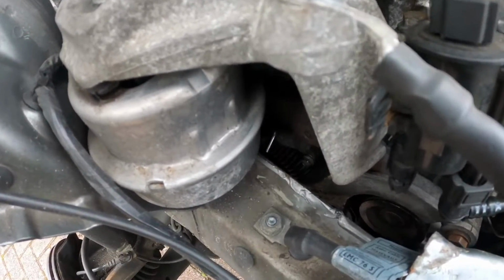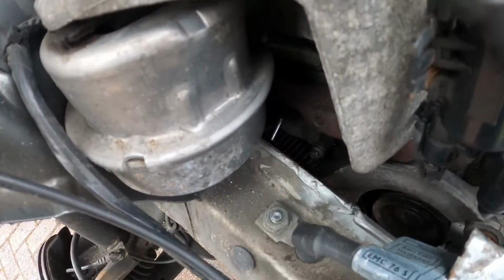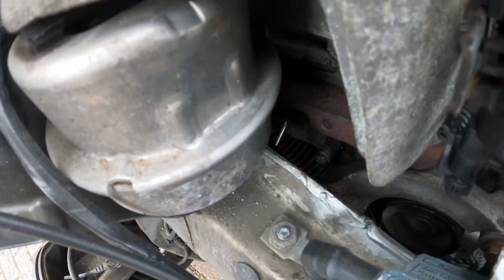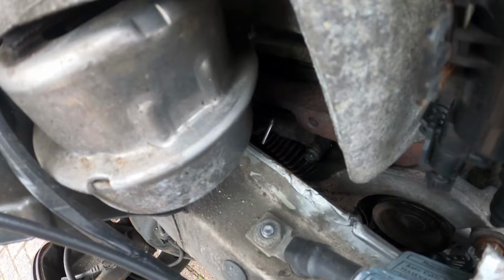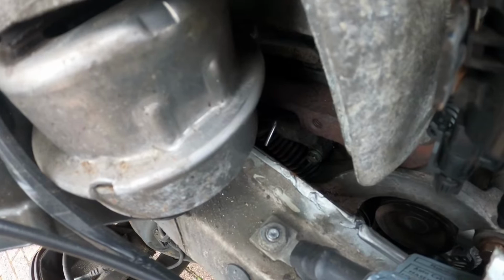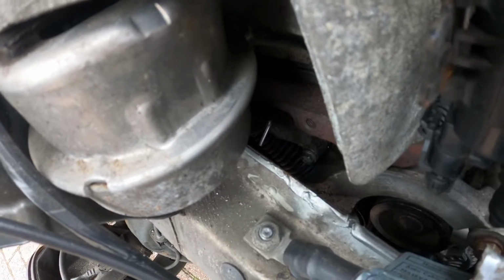Right, so to the person that's putting the locking pin in, you'll see what I mean when you're doing it. When the person pulling back with the belt tensioner tool is pulling it back, two holes are going to appear. You need to put the locking pin in the second hole, but we're going to put a picture in to show you what we mean.